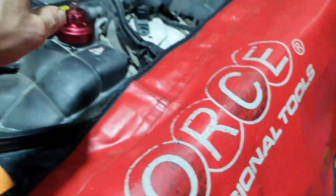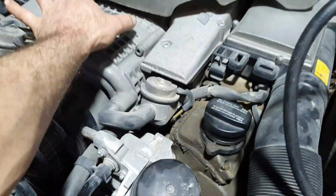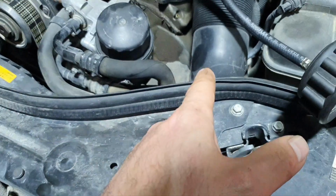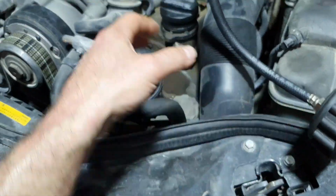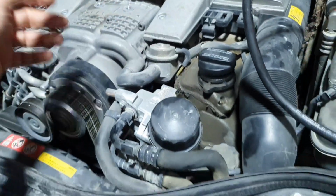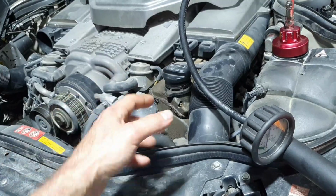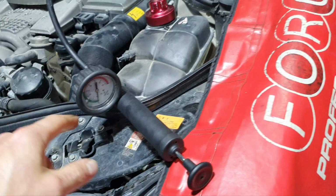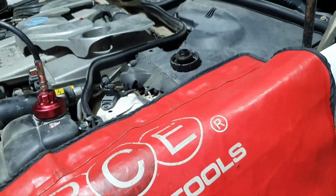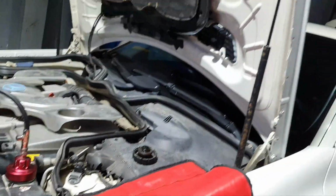By the way, what I saw yesterday, I saw marks here. You know what these marks are? Not on the fender, inside of the fender. This means that they put a bridge on the car before and hooked up the engine. Most probably that's why I saw the sealant on the oil pan, that somebody was there. They removed the cross member, hooked up the engine from here, probably, I hope so. And they opened the oil pan, I don't know for what reason. Maybe they already changed the oil pickup tube O-ring, the seal down there, it might be. So that's the story for now with A55.